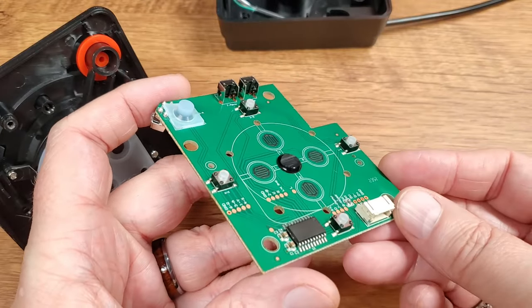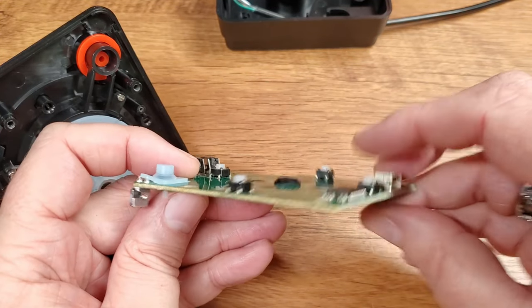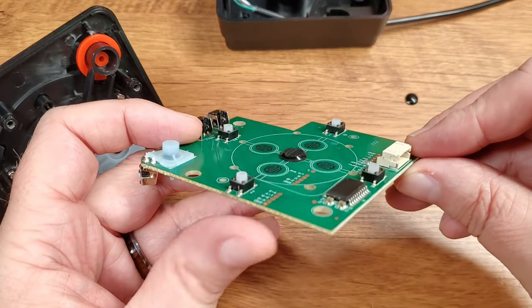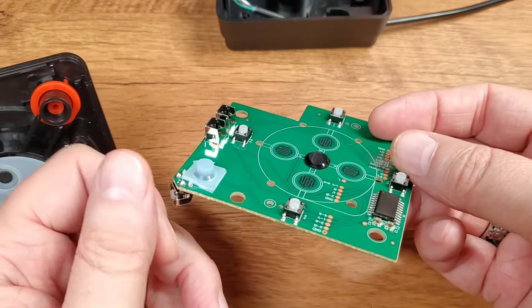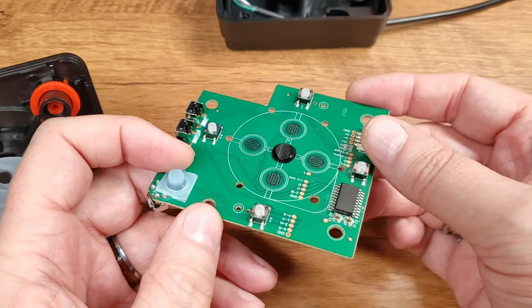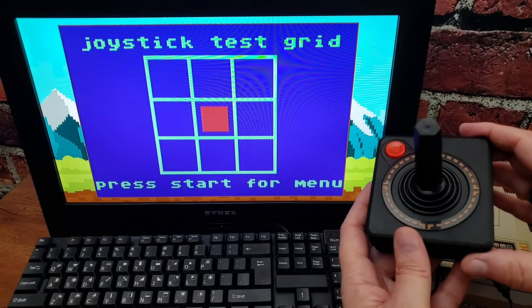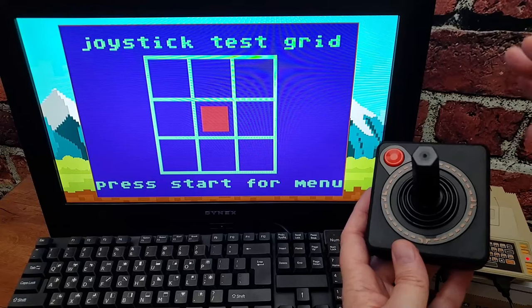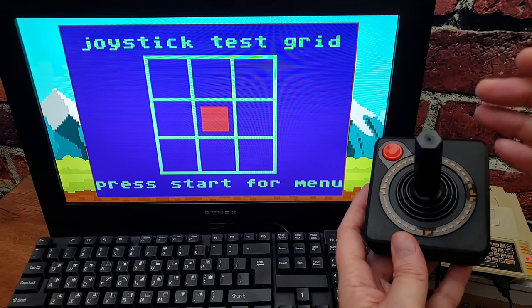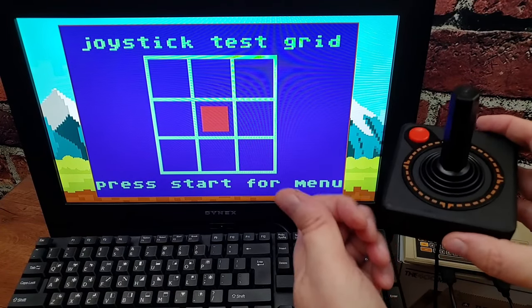So it's raised just a tiny bit — just a little lift. We'll see. If that's too much, we can always come in and shave it. Fast-forwarding just a bit: I did a bit of a test and found it a little too tight. So you can see I shaved the top off of that little nub — just a little bit, maybe a millimeter or so — because I found it a little too stiff. Plus I stabbed myself in the thumb with an X-Acto knife, but that's not a big deal. Let's put it back together again and try it.